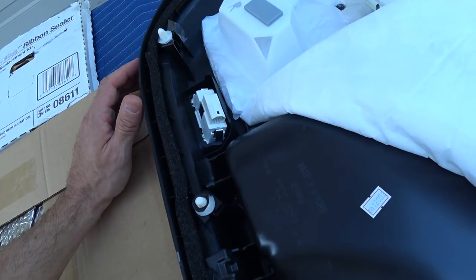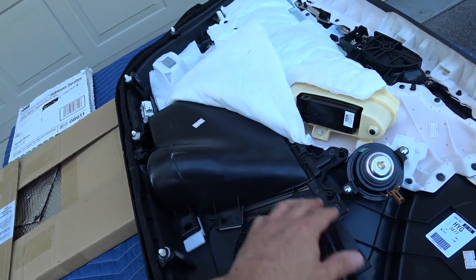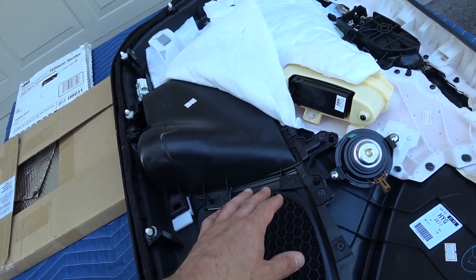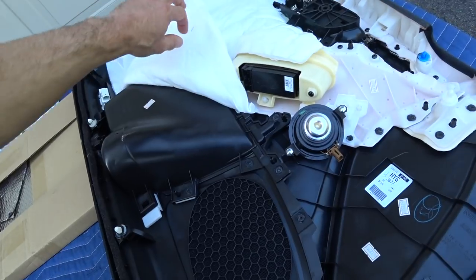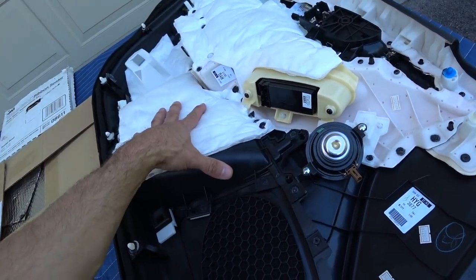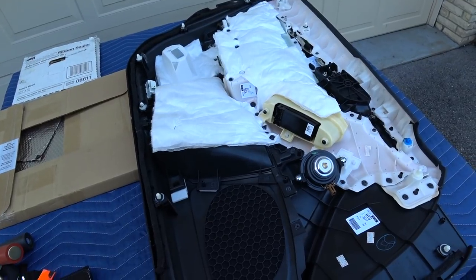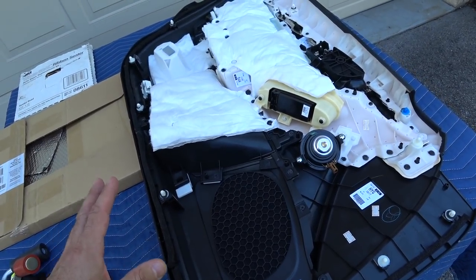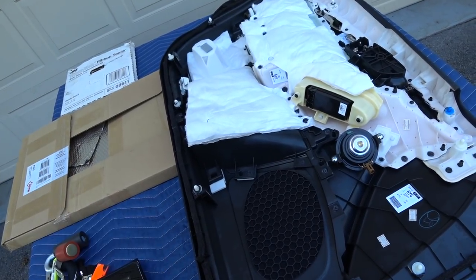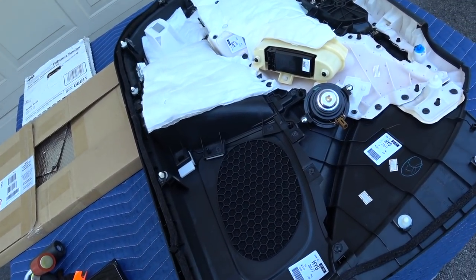When the liquid window weld sets, it fuses those two sections together. Even though it's plastic-welded, this isn't like TIG or MIG welding or a real rosette spot weld — it's mass-produced plastic welding, so there's always going to be a little tolerance. The machine may not have pushed it down far enough, or the part moved slightly in the jig. This is why it happens in so many new cars today — production processes are so quick that you can't QC everything. It's just not possible with the way cars are made today.